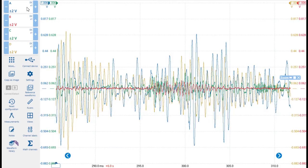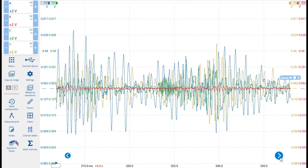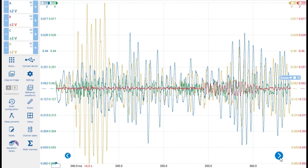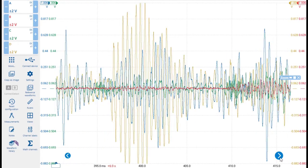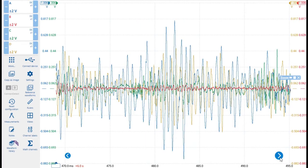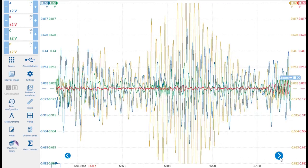The yellow channel, which is number four, that also is very large. But as I said, right now I got it hooked up to the injector, so that's probably why you're getting a large spike. But the blue one — I moved it from different places on the front cover and I'm still getting a large spike. That's kind of helped me narrow down where this excessive noise is coming from. The red and the green are not that high in comparison, but I'm noticing the amplitude and the frequency of the blue channel is very large.